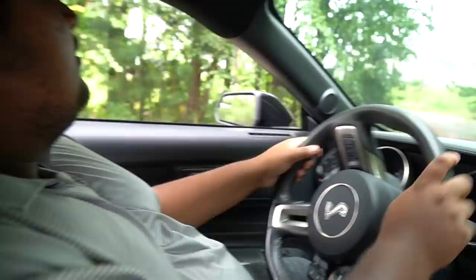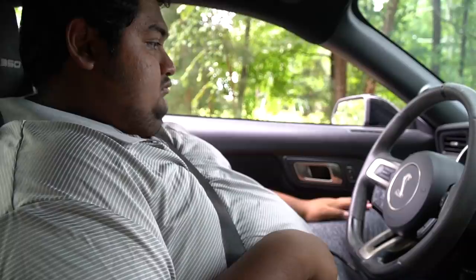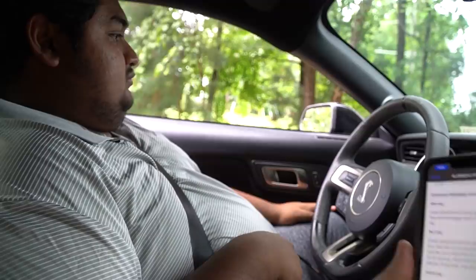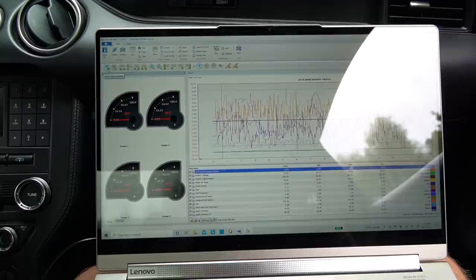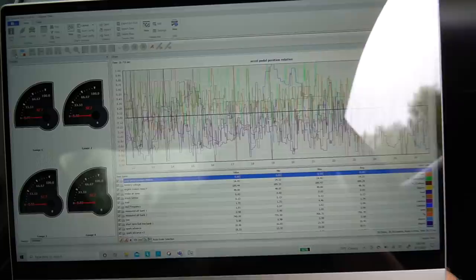Yeah, unless directed otherwise, get the car warmed up first, start the log idle for 30 seconds, then hold the RPM at 1500. Yeah, this is exactly what we do. So we need to do this one, right? Yeah. We're gonna let it record for 30 seconds idling, and then you have to hold it at 1500 RPM for 15, okay. 2500, 3000, and then that's it. And we'll let it idle for 30 seconds. All right, and now climb it to 1500 and hold it.